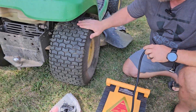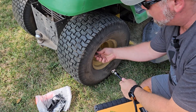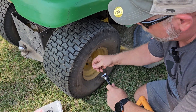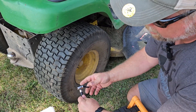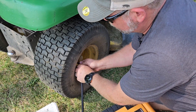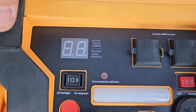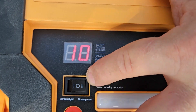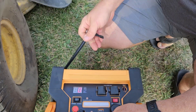So what we're going to do is check the tire pressure on our lawnmower here, make sure we've got plenty of pressure in each one of the tires. These back tires should sit at about 10 to 15 pounds. You just open this up, stick it on your valve stem, fold it over and close it. We're sitting at 10 pounds, so we don't want to go any farther than that.